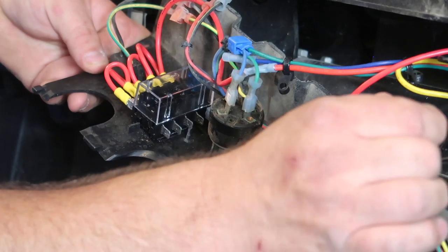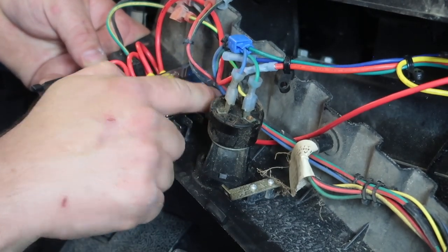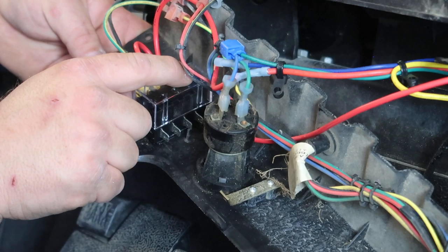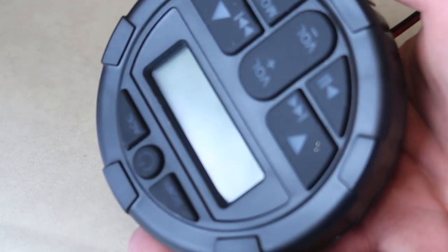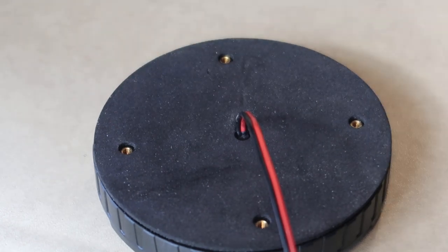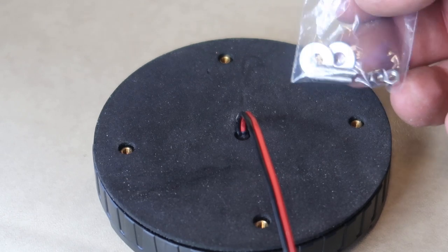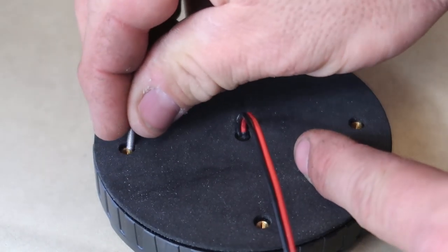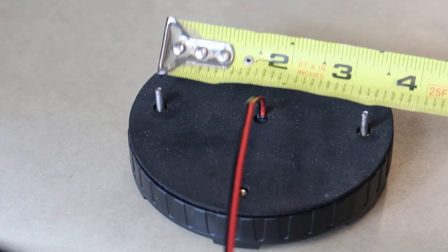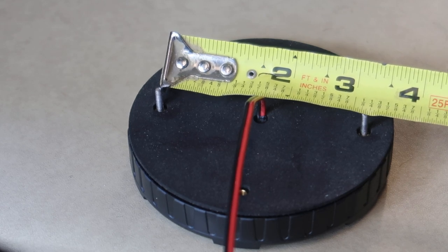The ground wire and power wire are going from the Bazooka Party Bar G2. The power wire goes into the back panel of the fuse block with a 15-amp fuse — the one that came out of the fuse holder with the power supply. This is the back of the dash remote. They have four female nuts already built into the remote itself. In the package, they give you two universal bolts, two nuts, and two washers to mount it. The mounting bolts are about three-and-a-quarter inches apart, and from each mounting bolt it's about an inch and a half to the center for the wire hole.